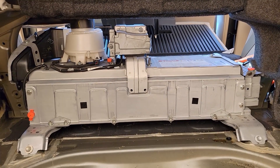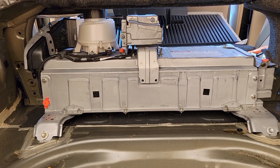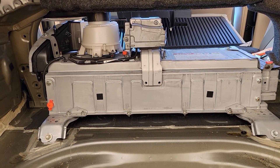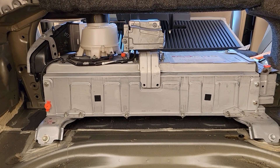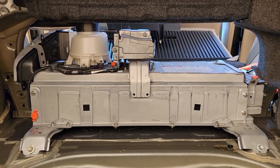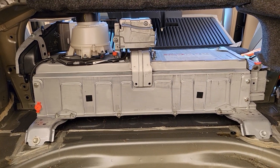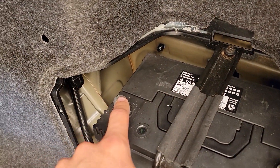From this point on, this is not an instructional video — this is just how I do it. This is high voltage and very dangerous. Since somebody else already worked on this car, I don't know if any wire is touching the battery. I'll use my multimeter to check voltages everywhere and my protective gloves to be 100% sure. Use this video as guidance only. Also, always remove the 12-volt battery leads before working on any car.